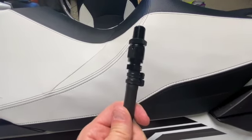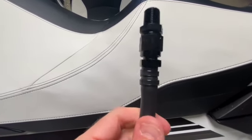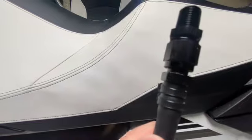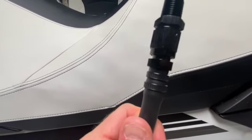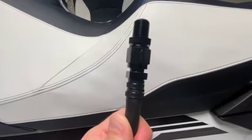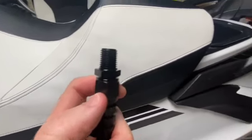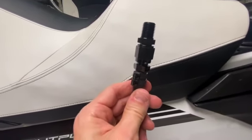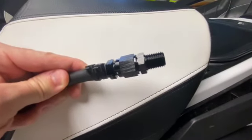These were the fittings from the auxiliary gas tank. I took them off and put them on the fuel line right here — just double zip-tied it. A tip: getting this fitting into the line might be a little hard. I just ran it over some hot water, loosened up the rubber a little bit, and it slid right on — no problem. Now I need to get a bit that's a little bigger so I can drill the hole. When I take the tank off the WaveRunner, the line will retract back into the hole, I'll put the pigtail on, and it'll be safe to ride.